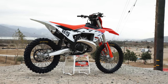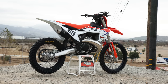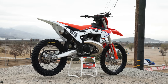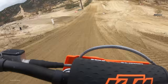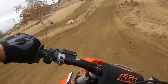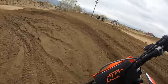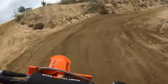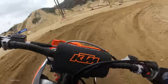So the big question is: how does the KTM 300SX run on the track? This bike is masterful in the corners. Because of its smooth roll-on power, you're actually able to navigate every type of corner with ease. Typically, tighter, off-camber, and technical corners would be much more of a challenge on a two-stroke, but the instant pickup coming off the crack of the throttle gives our testers a much more manageable power right away. In the mid-range, the extra 50cc is noticeable in that you don't have to shift as much compared to the 2023 KTM 250 two-stroke. The stock carbureted 2022 and prior KTMs took some serious clutch work to get into the power and weren't as easy to lug around in the corners — you needed a really good engine tuner or to know what you were doing with your carburetor to get that smooth lug-on power.